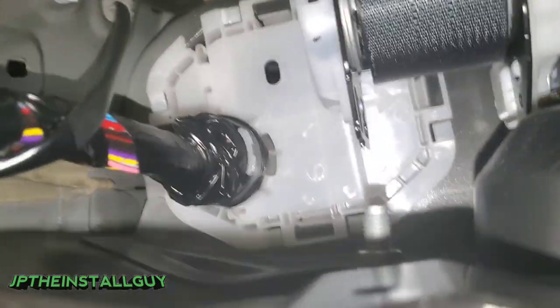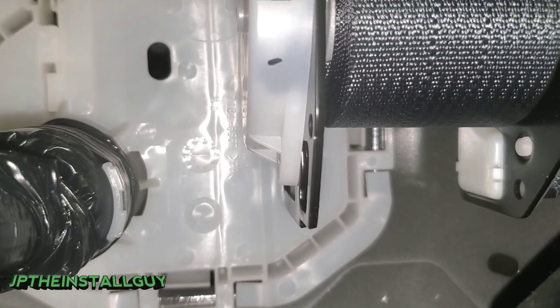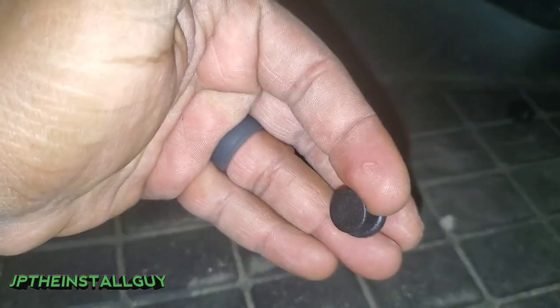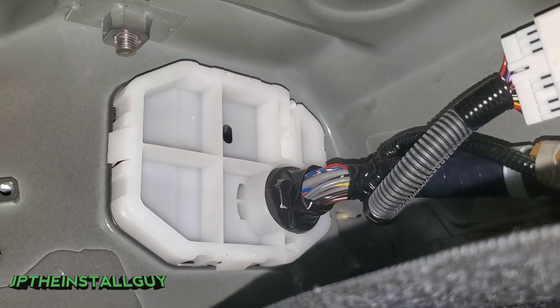If you look on this passenger side, you see this group of wires that's actually going through that hole right there. You could try to run it through there, or somebody like me is just going to drill a hole big enough for my power wire to go through, because on the other side is literally nothing. When you're in the trunk, you're going to have to drop this trunk lid down and you'll see a bunch of holes like that — there are some across the back right there as well. They take the exact same clips that we just got done taking out earlier, so you pop that middle piece up and then pull it down. And then once you get it down, absolutely nothing on that other side. So what we can do is expand that hole that's in the middle a little bit bigger with one of our step drill bits, and then we'll be able to get our power wire all the way through.